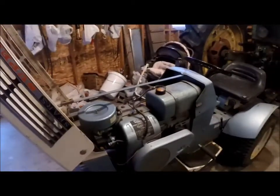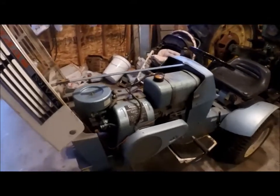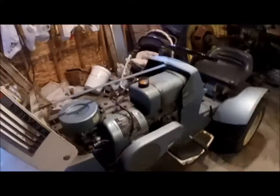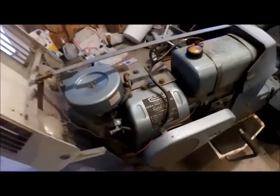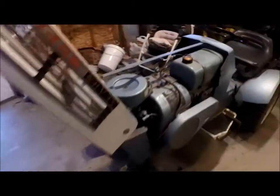Cameraman Dan's going to help me out with it while he's up. We're going to get it running, and then we're going to start tearing it down, because it needs some things worked on — that wiring. I don't like how it's wired, I don't like how the fuel line is ran, and judging by the fact that there's paint on that fuel line, it's probably the original, so it's got to go. I'm not going to fool around with old fuel line — it's going to crack and leak.